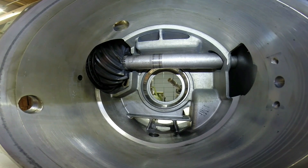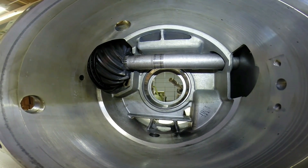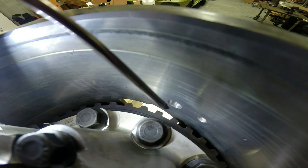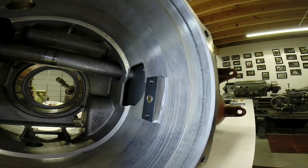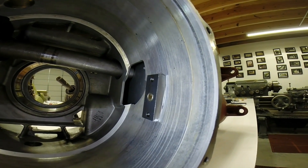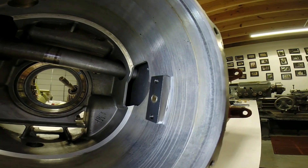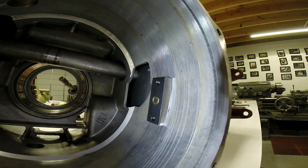Here you can see the alignment of the main shaft and the pinion gear inside the differential case. The case support shoe goes into location after the ring gear is put into place. Here you can see the engagement of the 50mm bolt that engages the support shoe for the case — it's long enough to hold the support shoe but not too long to engage the ring gear as it rotates.